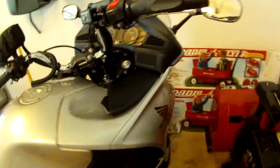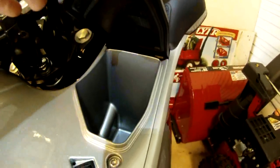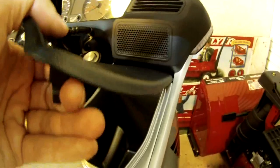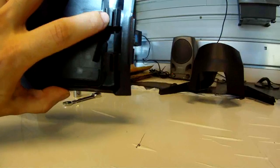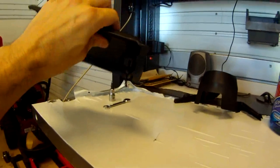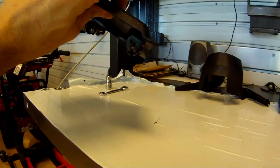The next thing is to remove the glove box door. The door is on a hinge and you can see where the hinge is right in here. You open the door approximately to here and pull back in this direction — and off it comes. On the back side of the hinge you can see it's open in a couple of sections. The objective is to open the door until those open slots hit the flat spot of the bar holding it on, and it just pulls right up.